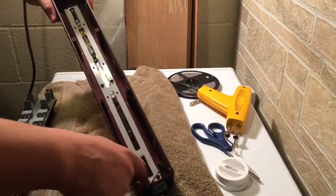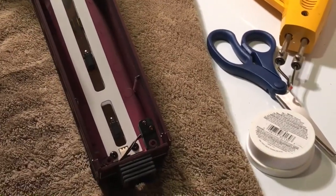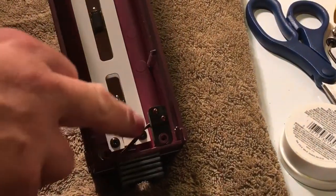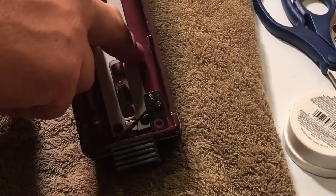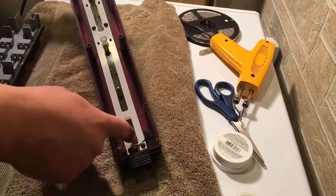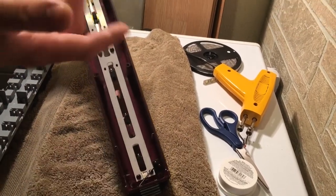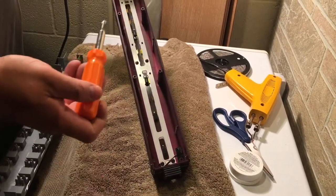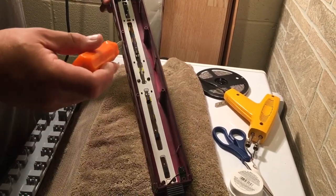In here, at the top, you have from your spring connections here that hook up or touch off onto the base of the car, you have two wires, your positive and your negative, and they're going to feed into here, and you're going to have positive and negative going to, and then these clip in. And like I said, they're kind of like Christmas tree lights. They're incandescent, they're not very bright, and I believe these were originally 14 volt bulbs in these cars.